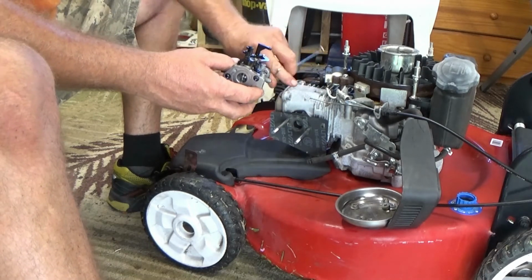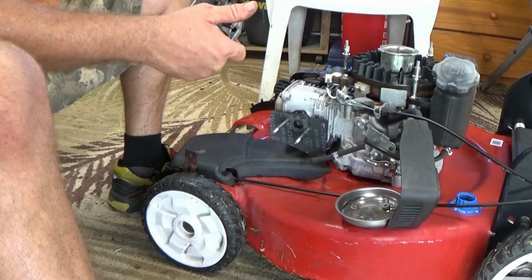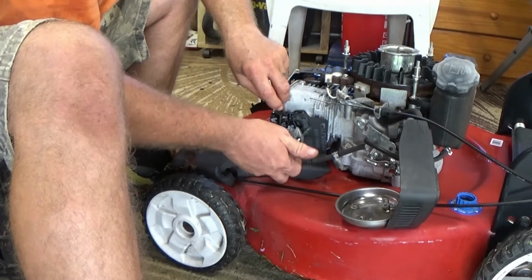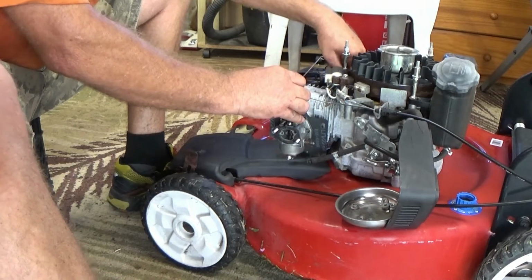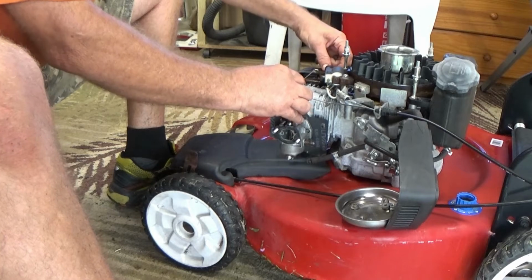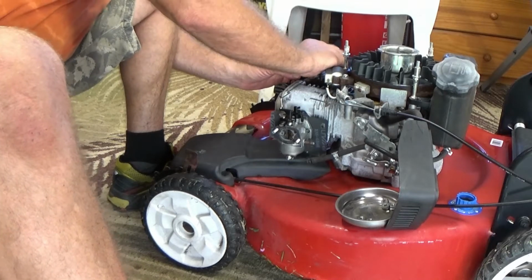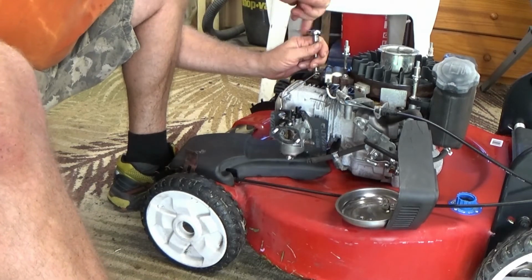That's the little lever for the choke. So that goes in there and around there, and then it hooks in there, but it doesn't go on. So we put that on like that, and then that slides in, and the carb goes on in its place. And then this jobby, which is the little thermostatic type thing that controls the choke, which is actually bolted down onto the exhaust manifold, or the exhaust thingy. We'll just call it the exhaust. That stays right there. So I'll just get that on in place real quick.